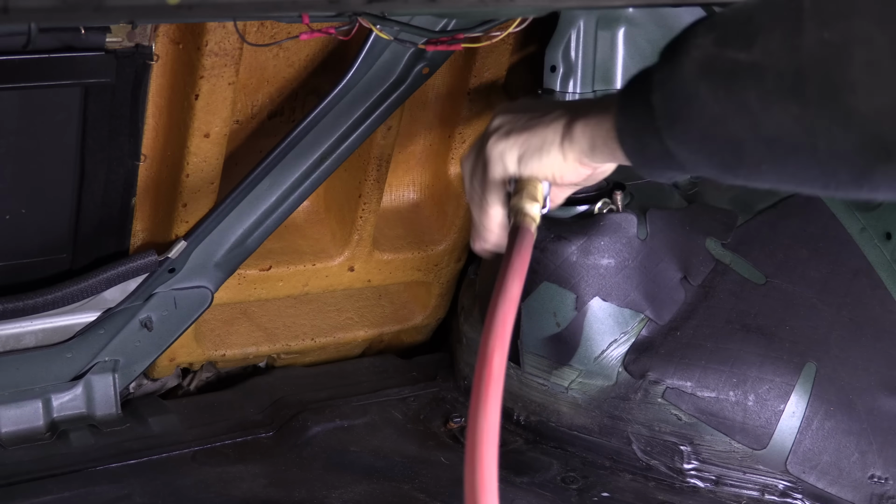There was one hydraulic line that I should have removed earlier to make this easier, but I didn't. You'll see it bite me. But now that the end links are detached, I can move the sway bar out of the way and get to the rest of all these bolts that I couldn't get to before. The lower control arms are already practically free, one long bolt left on each. This is where that hydraulic line bit me. No biggie though, I put a bolt back in, took the line off, pulled the bolt back out, and then dropped it. There, there's the front steering rack. The stupid hydraulic line ends up being last of all.